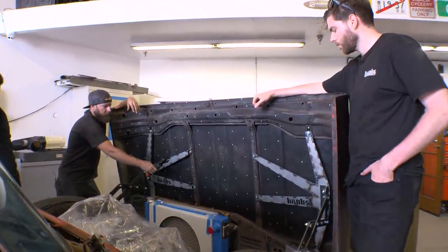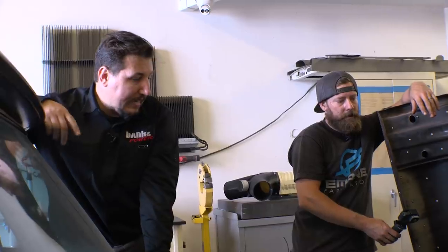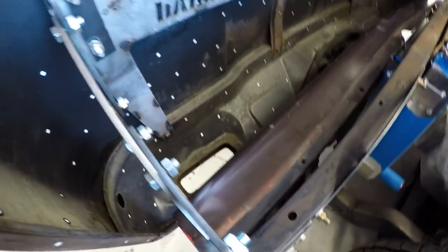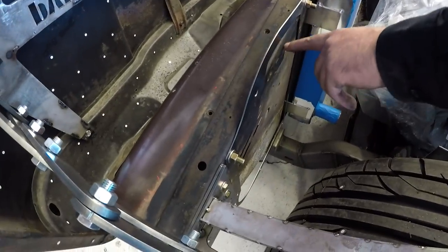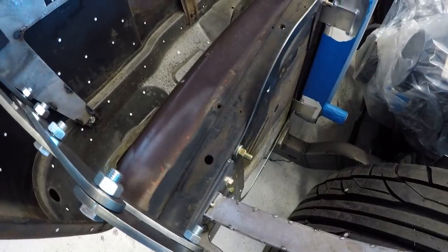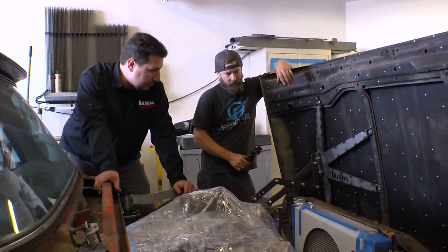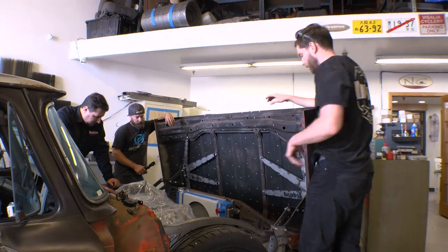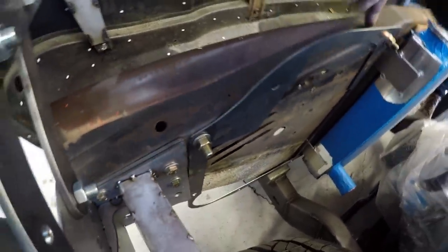Are you guys using any of the grill on the front of the hood? Does any air need to go through that still? The air through the grill and the hood does come through the radiator — it'd be nice to keep it open so the air travels through. We pulled out the turn signal buckets last night because the new overall shape for the top of the core support will slightly crash into them. We've got a couple more pieces designed that when this core support gets cut out, they come back in and follow this shape and cap over the top so all the strength goes back into the core. Same with the bottom — don't make anything on the core support until we send those over to you. It might just need a minor notch to suck up in, and we can do the overlay and build it back up.